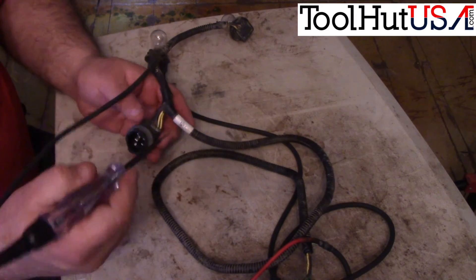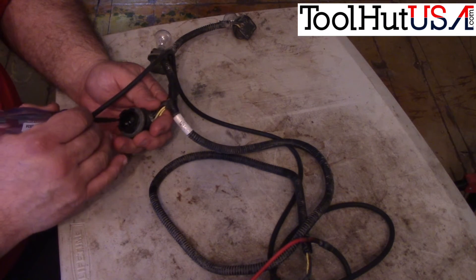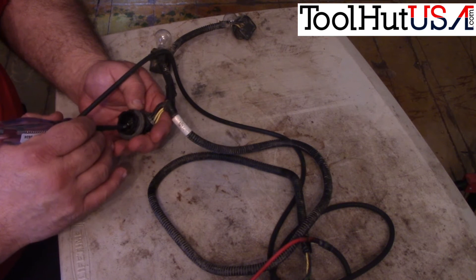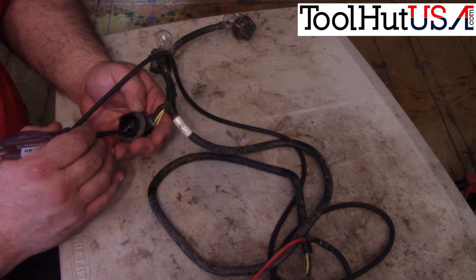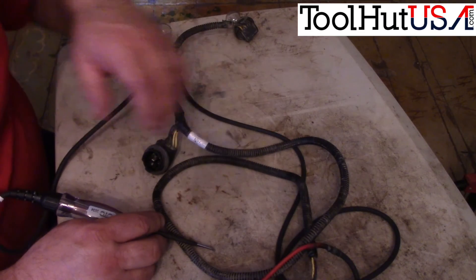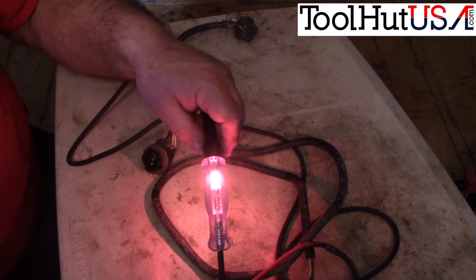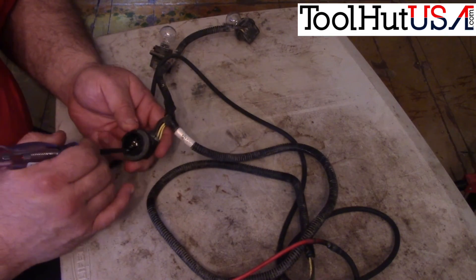Now that I've got my circuit fired up, I should have power at one of these pins — and I don't. Let me make sure I did this right. Okay, there we go — my splitter's got power to it, going up to the brown wire, coming up to the first connection. I don't have any power there.